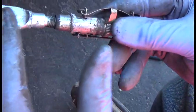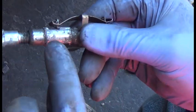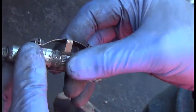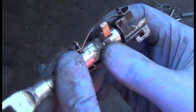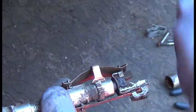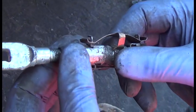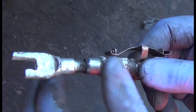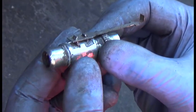As you use your brakes, this mechanism is supposed to turn and get longer. This whole mechanism — these parts are separate, but look, they are totally seized. I should be able to turn that by hand and I can't. So we're going to put a wrench on here and another wrench on here, turn it and free it up, then spray it with rust check and put it back together.